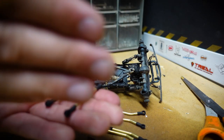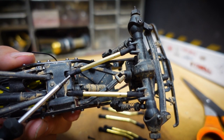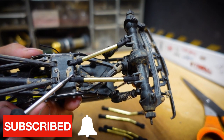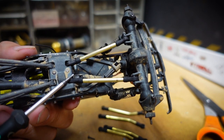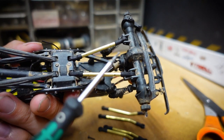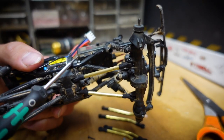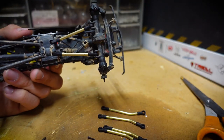Here's the first set of links on the C10. It was pretty simple, as long as you're able to pop out your old balls and pop them into your new links, it should go pretty smooth. I definitely recommend doing one set of links at a time to keep things organized. Now we're going to move on to the Y-link, which is a little bit different.